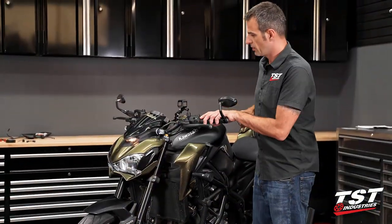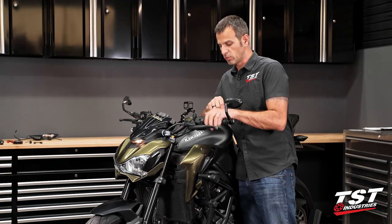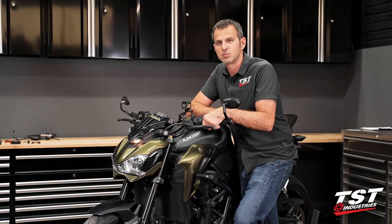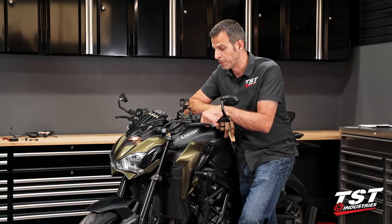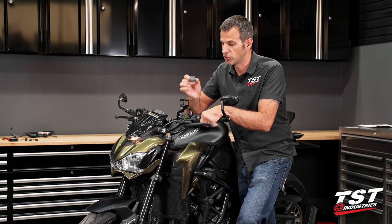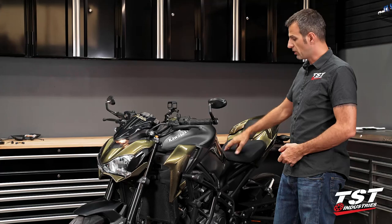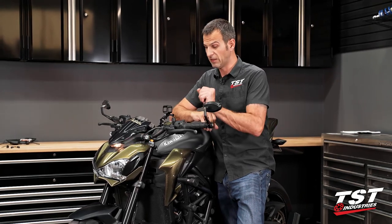Let's test our installation. We have the running lights going — that's looking really nice. You can get these in a number of different colors; the choice is up to you. Our signals are working, although you can see here we are hyper-flashing — flashing faster than the OEM speed of 85 cycles per minute. This is because we went from incandescent light bulbs to LED type signals, which is very common on most motorcycles. You either have to wire in some load-balancing resistors or change your relay to an LED type setup. We do have a Gen 2 flasher relay on our website — it's plug-and-play, really easy to install under the driver's seat, and you can adjust the flash rate beyond 85 cycles per minute if you want.